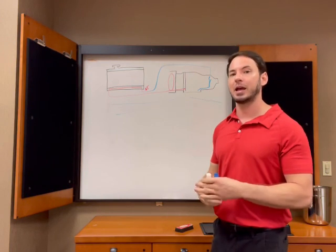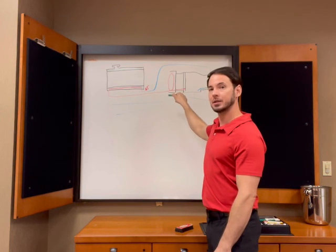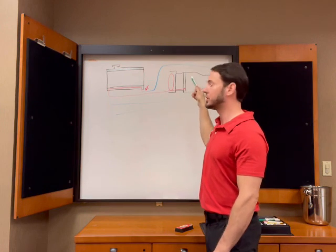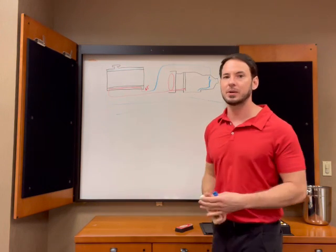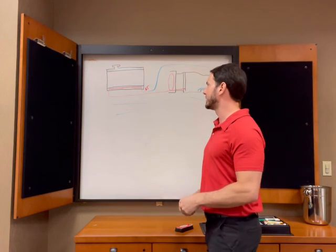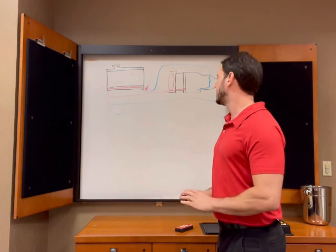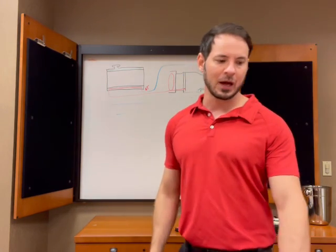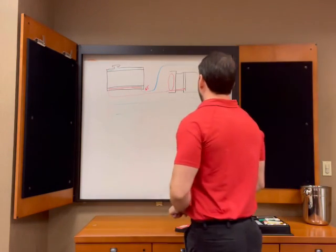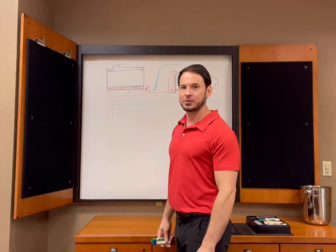Again, like I said, if we have that torque converter unlocked, that's how we're gonna generate the most heat in our transmission. So we're actually trying to use the transmission to heat the fluid. Of course, nobody does that anymore because that's a horrific waste of fuel and no one really cares anymore because our fluids are way better. So we've got all that, right? So question, and the answer should be obvious to everyone that's still with me after I've droned on for this long.